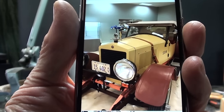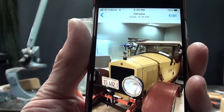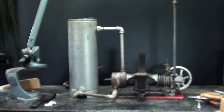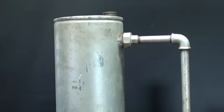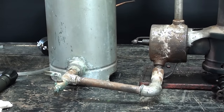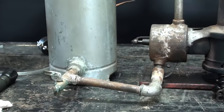First of all, I just got back from an antique mall, and that is an old Essex automobile — do not confuse Essex automobiles with this engine; they have nothing whatsoever to do with each other. The first thing I did was drain the cooling tank, which holds two gallons. In there was a mixture of antifreeze and water, about a 50-50 mixture. I tested it and didn't really need to drain it, but now I know what's in there because I put in fresh antifreeze — again 50-50: one gallon antifreeze, one gallon of water. I probably should have used distilled water.